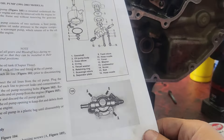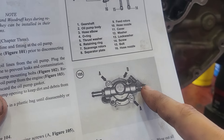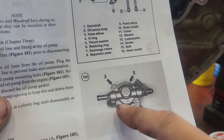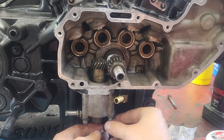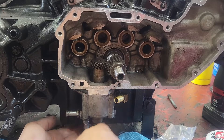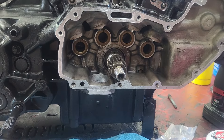Disassembly — remove the oil pump housing screws. Your oil pump has two screws, quarter-inch Allen bolts, your quarter-20s, that hold your pump in place. And then these other two hold it together. You can wiggle that out of the way and — bam — oil pump. If you have your cams in, you're going to have to fiddle with it a lot more. Nature of the beast.